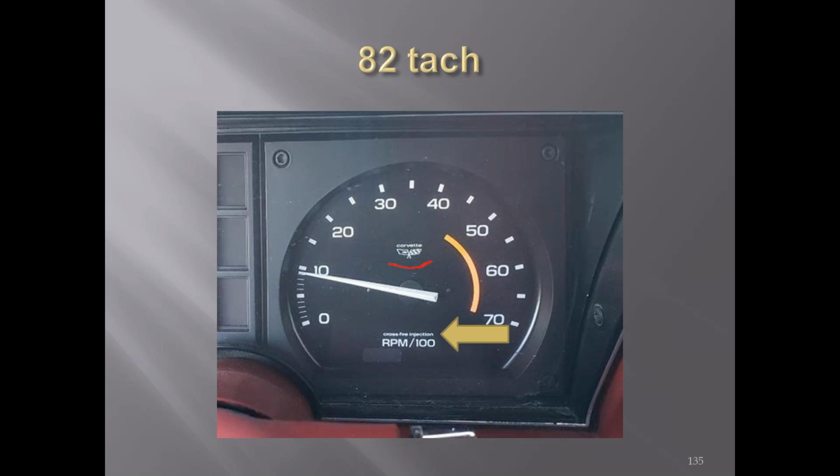When you talked about the wiper override warning on the early C3s, how would that warning light get cleared? Will it automatically turn off once the door opens, or is there a different procedure? Yes, from what I understand, the switches down in there, when they open up, will shut it off. Correct, Gary? That's correct, but if you turn it on and the light comes on, that could mean the round knob at the bottom of the column would need to be turned to turn the power on to the motor, or it could be that the door isn't open. Then you would pull the wiper switch knob down, the vacuum knob at the bottom of the steering column.